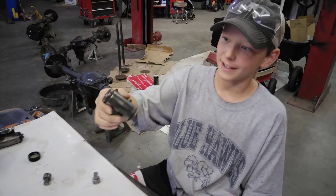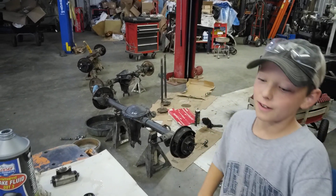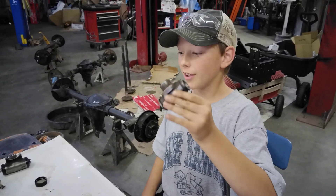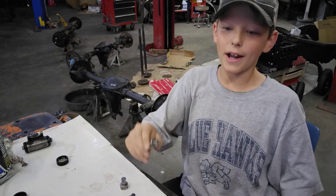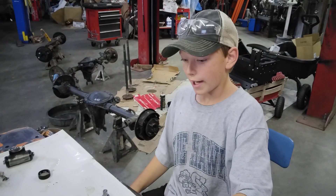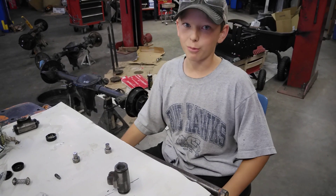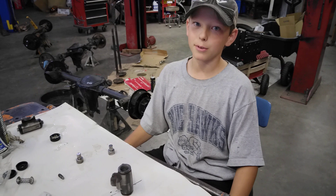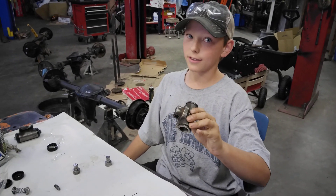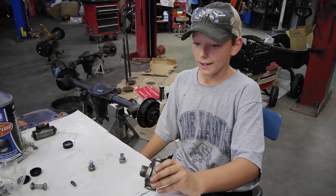It's kind of been a hard journey to get these cylinders right here. Off of those three rounds right here, I take off six of these and take out all the parts and clean up some of it, just to find out that they're rusty or the pistons are scored up bad. And this one wasn't too perfect either because we had to hone this out to get a straight nice bore. It's been kind of a journey, but the reason why I didn't just buy these new is because I just wanted to learn how all this stuff works. Most people just buy them new, but one thing I gotta say is I would not buy any of these that are rebuilt, considering how bad these were, because I'm sure the people at the factory would just slap them together with those bad parts and it wouldn't be the best.